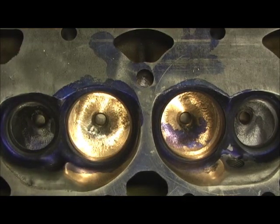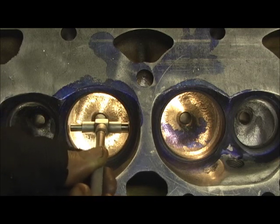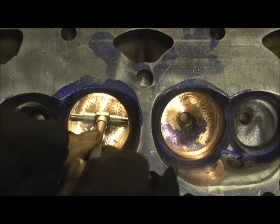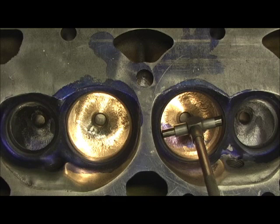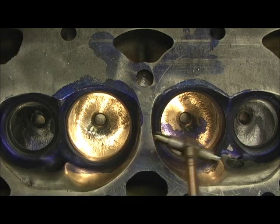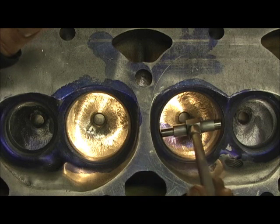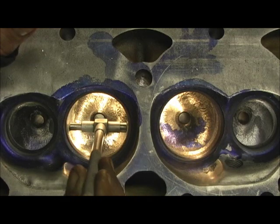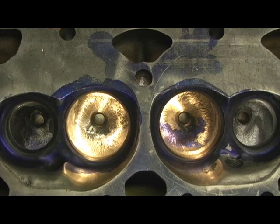I went ahead and switched to the big giant burr just to make a swoop. This is just pulling it in and leveling. Look what I got. I snapped it at about the biggest point, which is going to be our little screw twist right there. Look what a transition I got. Now I have got some touch-up to do — I'll do that with the smaller one. But watch what happens when I try to go in here once again. Look at the reflection of the light. Look how dark it is in there. This ain't just a reflection of aluminum — it's also a reflection of the port light, of the light being able to shine on areas hidden. Look what's happening to the snap. It has to go all the way down. I come in here and it's pulling in. So this is just the roughing. I pulled it in. I'll go back in there and finesse.